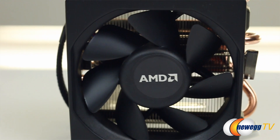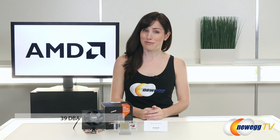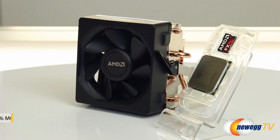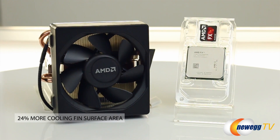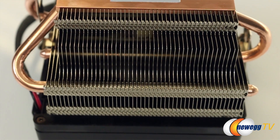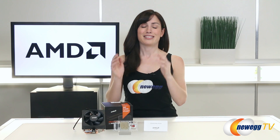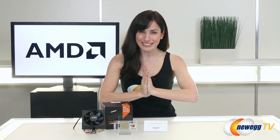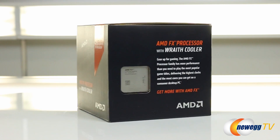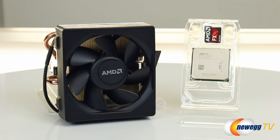The first thing I really like is that the noise levels on the Wraith are really quiet. We have the noise levels topping out at 39 dB compared to 51 in its predecessor, which means it's 10 times more quiet. AMD also enabled this with 24 percent more cooling fin surface area and 34 percent more cubic feet of airflow per minute. It's also designed to move air over nearby motherboard components, so the Wraith can improve cooling on your whole system, not just the CPU. Basically it has near-silent operation and great cooling performance — the Wraith isn't going to allow you to run wild overclocking, but it is a dramatic improvement over the previous thermal solutions.